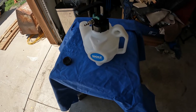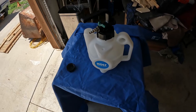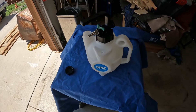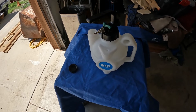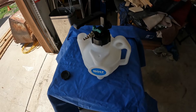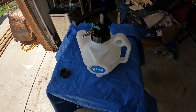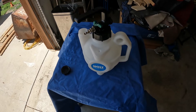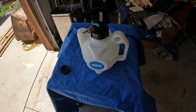This little unit did a good job. I'm pretty happy with it for the price. The brake pedal built pressure right away, so I don't think there's any air in it. I test drove it — it brakes fine, in fact it seems to brake firmer than before. I got a lot of the trash out of there and I'm happy about that. I might flush it again in a couple of weeks since it's so easy. My mechanic buddy says change your brake fluid every two years — don't go by mileage — and now I have no excuse. I paid $89 for it, but when I first saw it at Harbor Freight a few months ago it was on sale for $69, and with a 20% or 25% off coupon you could save even more.